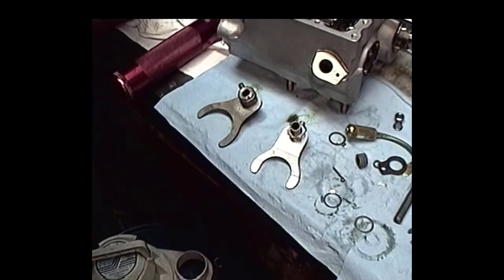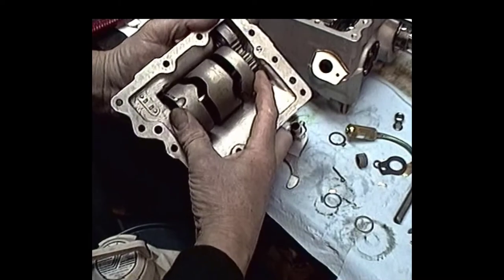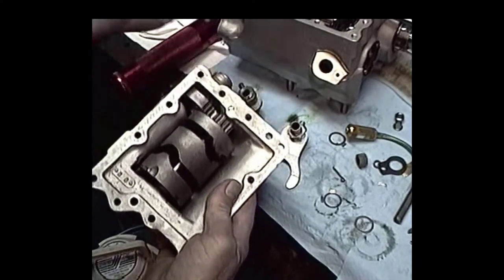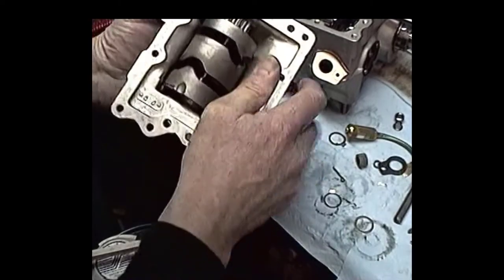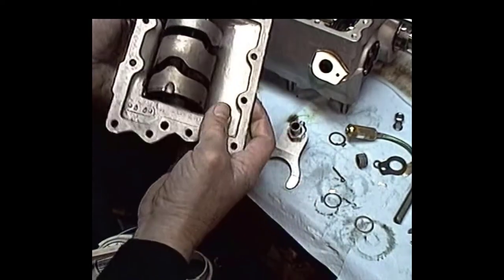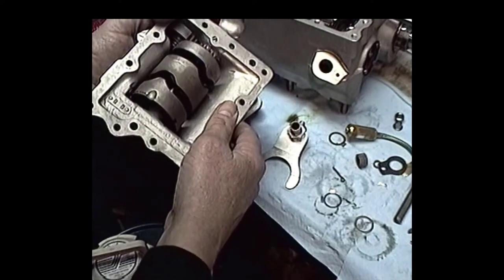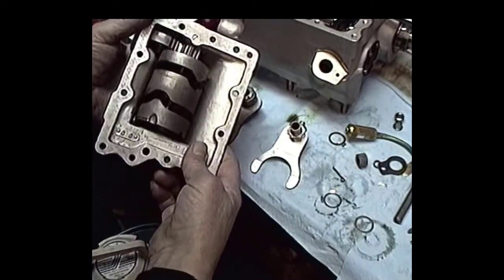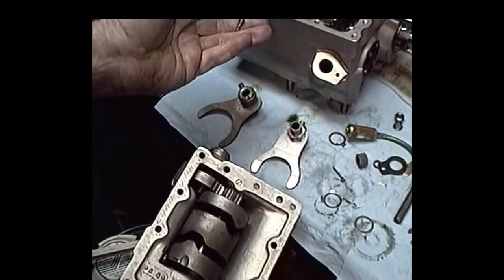One thing I did want to say, I did have a little bit of a problem with the shifter lid. The thing wound up having about 15 to 16 thousandths in play. So that was one problem. Another problem, when I pulled this apart, you had your little locating screw, and this thing is busted. That was to hold the drum shaft in. And evidently the last person to put this together, when they put this shaft in through the drum, went in too far, and this pin wound up tightening down on the actual shaft part, not the groove, and it broke the pin. The pin was sitting in there cocked, and I had a hell of a time getting that out. So I wound up making a new one of these. When I got through with it, this is what they look like. It's a whole one there.